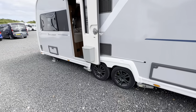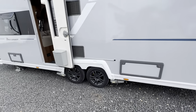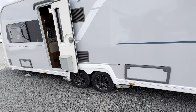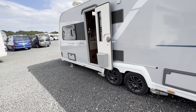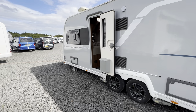When you're ready to drive off, hit the on button and hit the up button — it'll bring all the levelling system rams and legs up so you're ready to either use your motor mover to move it onto your towing vehicle, or put it onto the towing vehicle. You must have your levelling system up before you move your caravan.